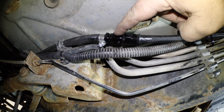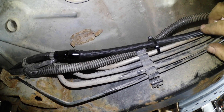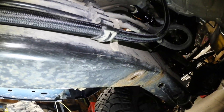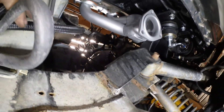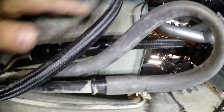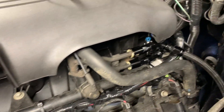I ran the barb with the 6 AN fitting — 6 AN to 5/16 hose. I wish I would have known this was a nylon hose when I bought it; I wish I'd gotten rubber instead, but it is what it is. Once I get to this part of the frame I just started using the clips and ran it up. I also rerouted the pressure line — originally I ran it coming down to the tunnel but rerouted it to come up by the steering instead. It's a more natural fit there, and then the return just fits up to the tunnel.